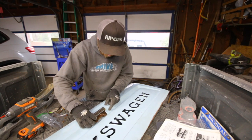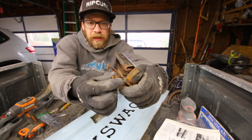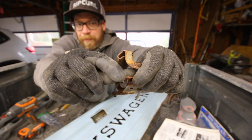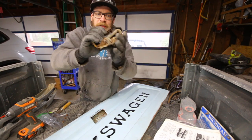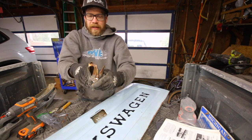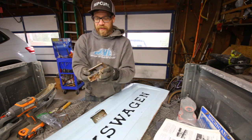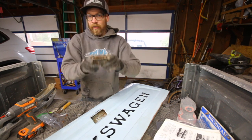I'll show you one of the clips. One of the clips is actually broken on this side. There's this little clip that clips onto the rod — you pop that off and then the rod just hooks in the hole. When you lift up on the tailgate handle it pulls them in and that's what undoes the hinges. This one's kind of stiff; I may end up robbing some parts off my other one if I can't get it to move smoothly.